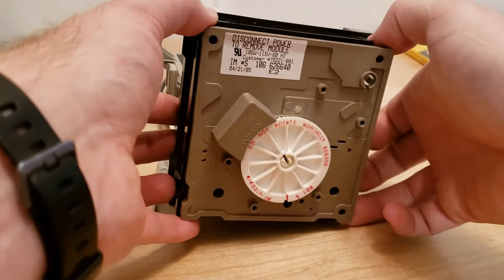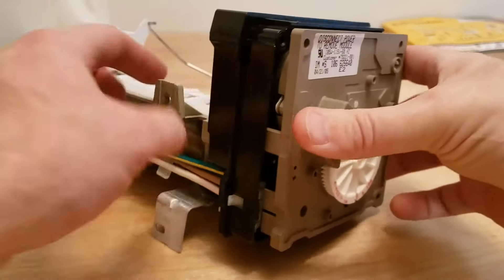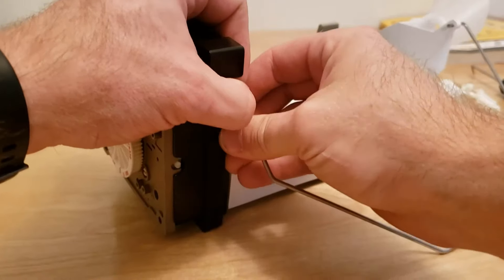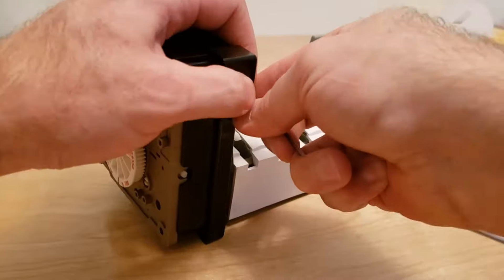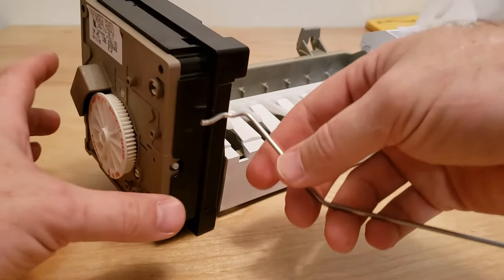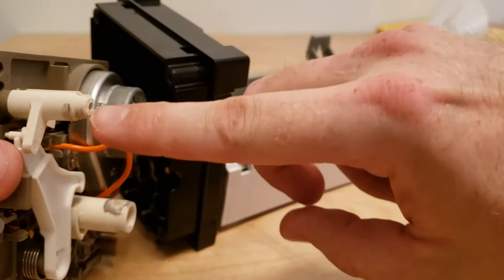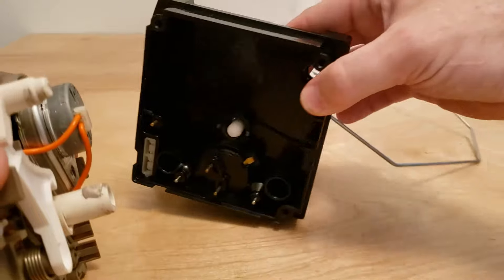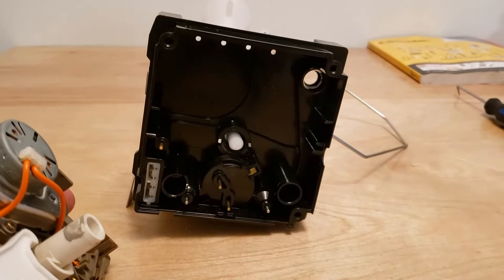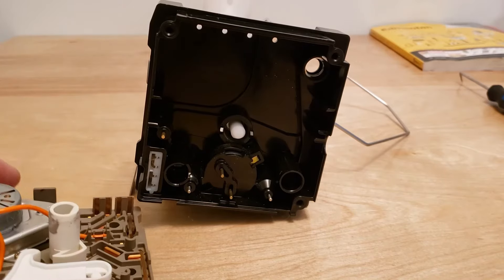All right, we've taken those screws out and this should just slide back. It's sticking because of the shutoff arm — you raise it up all the way and then kind of wiggle it out. It has a sort of bendy shape to it, which makes it a bit of a pain, but that arm sits right into that end there and won't let the head come off otherwise. And there are all the pins we were testing on. I can already smell burnt — as soon as I took this cover off — so something definitely fried up in there.